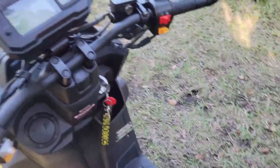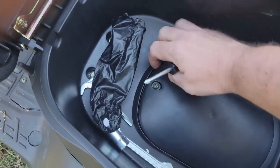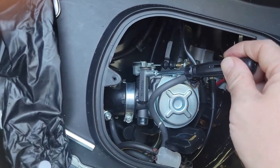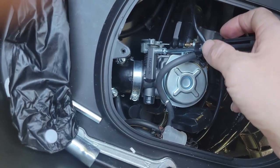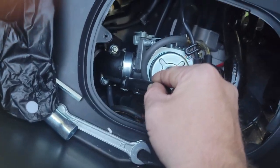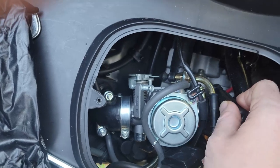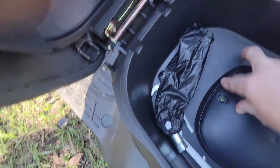The only thing I had to do when I got this was adjust the idle. It literally rolled off the crate and started right up. To adjust the idle, open this little compartment — this screw right here: go in to increase your idle speed, go out to decrease it. Also, one at a time, remove these nuts, put Loctite on them, and torque them back down. Do that with every single nut you can find — just one at a time. You'll thank yourself a month from now when all these screws would normally start to loosen up.